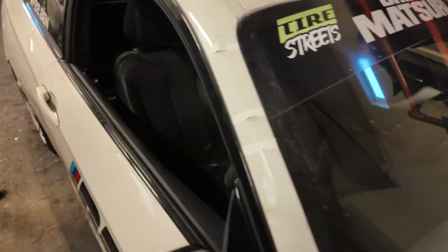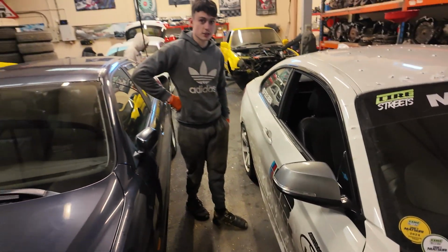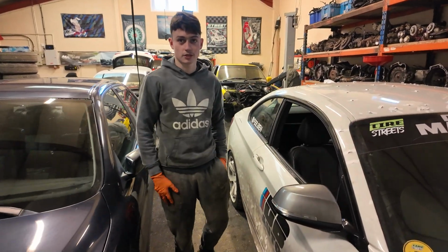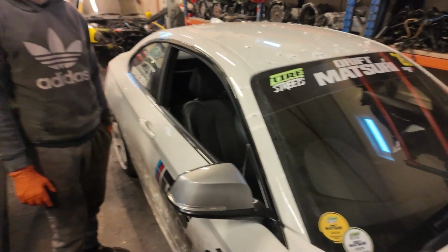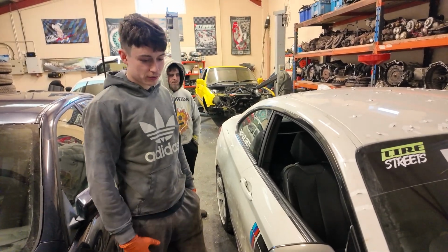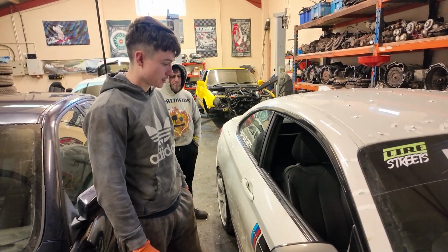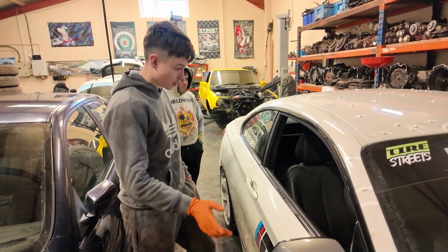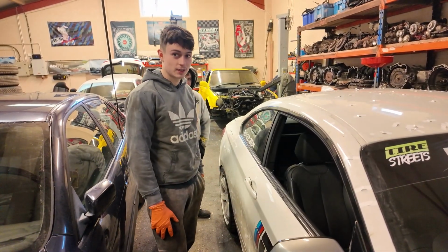Second hand, but a lot newer dual mass with a 6-puck clutch, so it will hold the power very well. We went for a 550i clutch and it was slipping straight away. Obviously with clutch kicks and stuff, it just wasn't having any of it. It's not gonna hold for long, isn't it? No. So this clutch will do 700 brake, which is fine with this, and I think with the dual mass, it's not too aggressive. Stock drivetrain, just a welded diff.